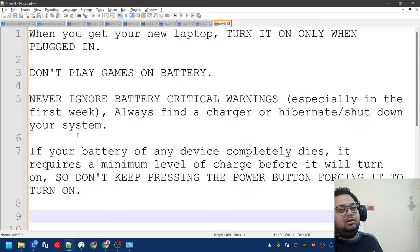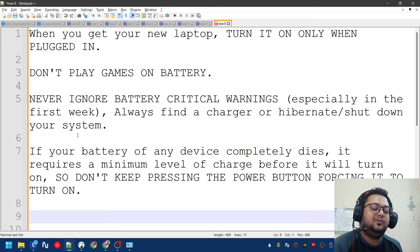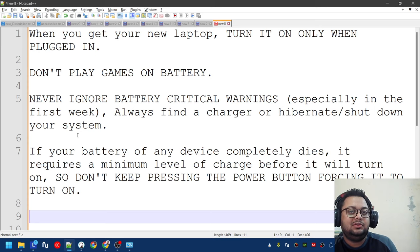Depending on the model configuration and how much you have overclocked your system, it might take some power from your battery, even when it is AC charged. This is what happens when someone gets a lower adapter charger with their laptop. Let's say the CPU GPU combo requires 160 watts and you only get a 135 watt charger, so the battery has to keep up. Yeah, that is my point.